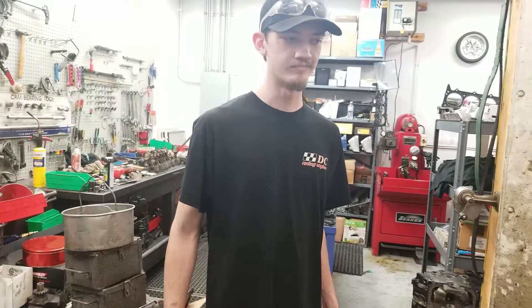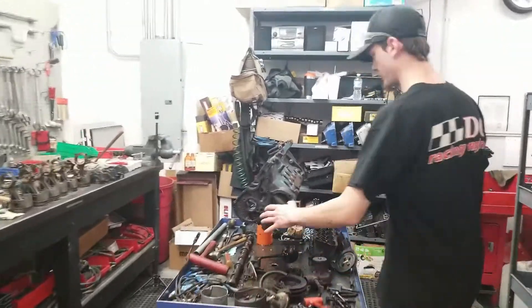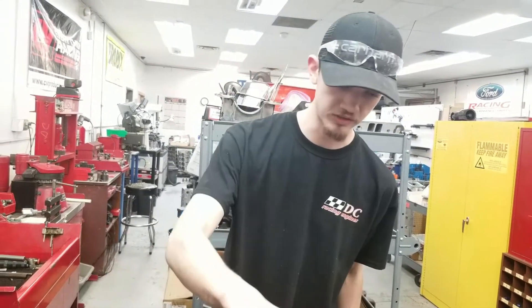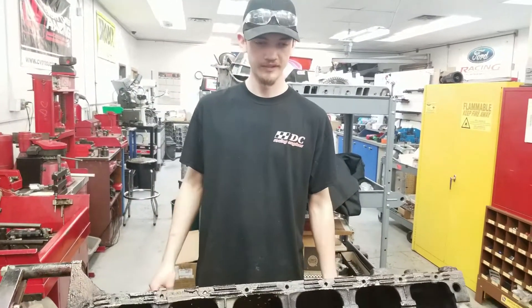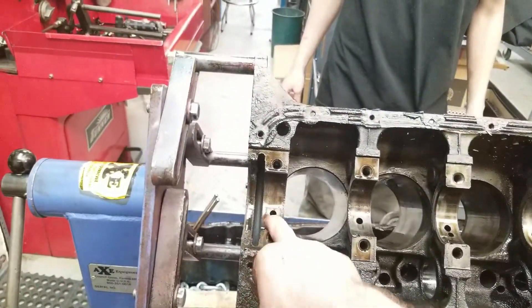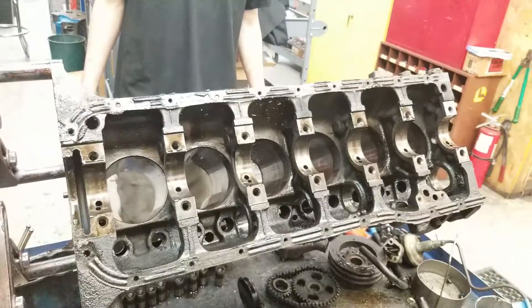So what are the next steps? Once we get the remaining plug and a couple of dowel pins out of the block, we'll take it over to another shop that bakes it down to bare clean metal — everything gets vaporized. Then we'll magna-flux it to make sure it's not cracked. After that we'll get together on parts. I've got a few parts on order — the biggest lead time item is going to be the rear mains, which are on an April timeframe due to pandemic supply chain issues.